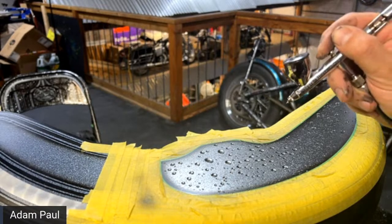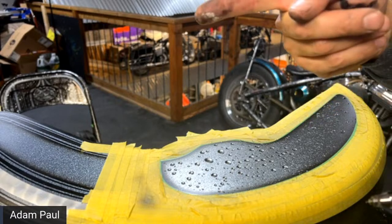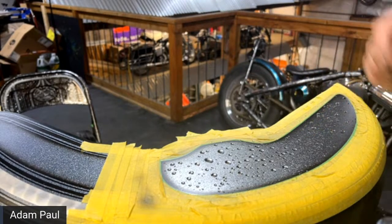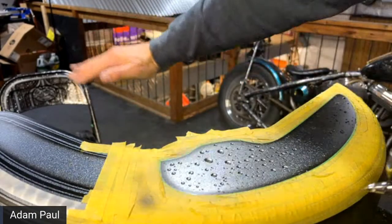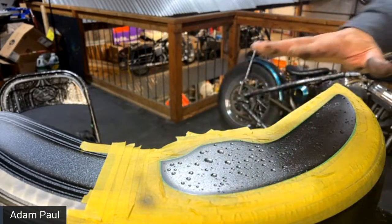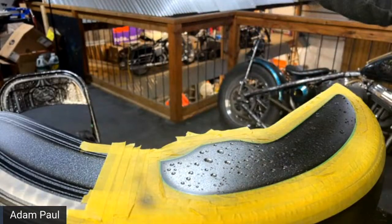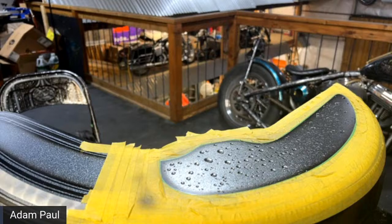Couple things. Someone said, do you do the white at a different angle and direction? And then someone said, so is that area black now? Yeah, so right now this is the silver that I just barely loaded up in the airbrush that I mixed over there. So this is just a fine silver base coat. And before I was working this way with the shadows, I'm working the opposite way with the highlights. And I'm not putting a whole lot down. I'm just kind of grazing past it. Really the shadow is what's going to make the look. The highlights is just a little bit extra.